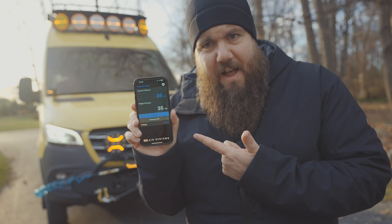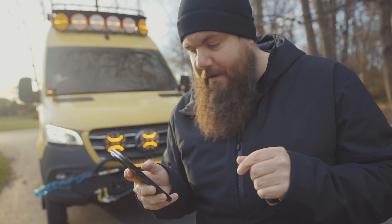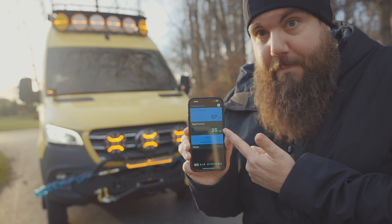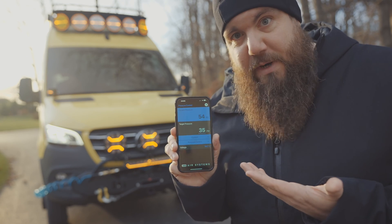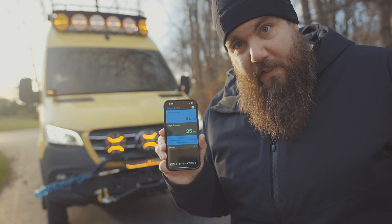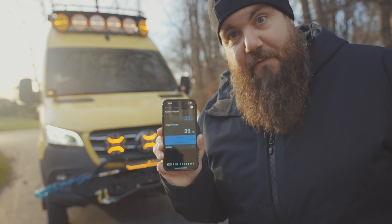I've got the ARB app out - I'm holding it near my face because the camera is defaulting to my face in focus. It's showing 35 PSI; it's not turned on just yet. We're going to go ahead and turn pressure control on. The van is bleeding off pressure right now - you can see it currently dropping pressure, going to drop it down to 35. So in the future, this is how I'm going to air down to a very specific spot. You can set presets and all that sort of stuff. The phone vibrates, and that is set at 35 on both front tires.